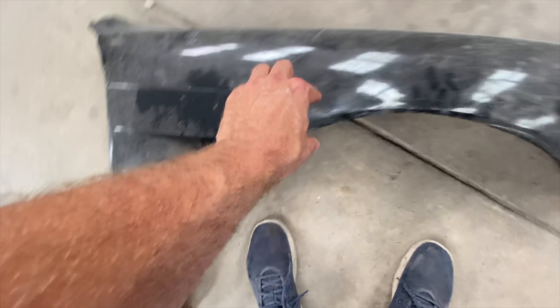One of the reasons I brought it over here — it made it really simple because you have a frame machine buddy across the street. My car just came over here, you dragged it over there and took care of all that stuff. So it went on a frame machine and they pulled out what they could, and then I built off of there. This strut tower was the one that was moved back — probably about three or four inches — and now it's within about a half inch of where it's supposed to be. I don't worry too much about the perfect location because all the suspension stuff mounts down to the subframe. As long as that's pretty well sorted, this is just going to mess up caster, which makes the car transition a little bit different left to right — but it's not so bad that I really have to worry about it driving.